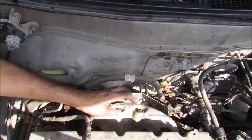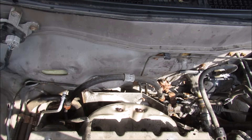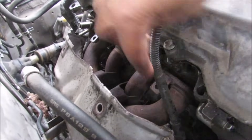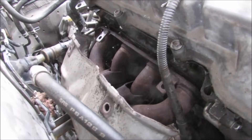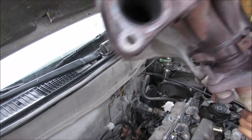Here at the back of the engine we've got this exhaust shield that needs to be removed because we need to remove the exhaust headers. So now the exhaust shield is out of the way I can work on removing the exhaust studs to get it off the engine. I'm going to lift it out, and here is the exhaust manifold removed from the engine.